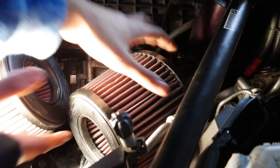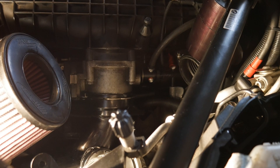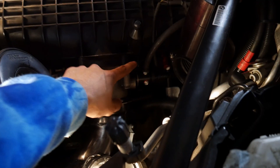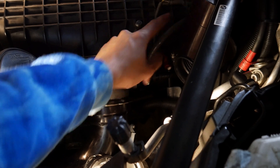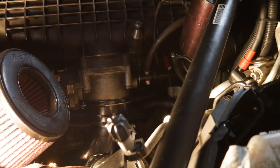So the first thing I'm going to do is take off this cone filter — that's pretty simple. And as you can see, I already attached the brake booster adapter to the throttle body. That's where I also took the vacuum line for my blow off valve so I can have a larger diameter so it's more responsive. So that's already set up.